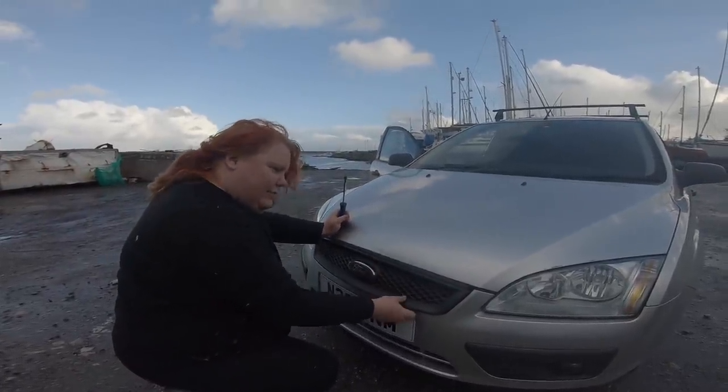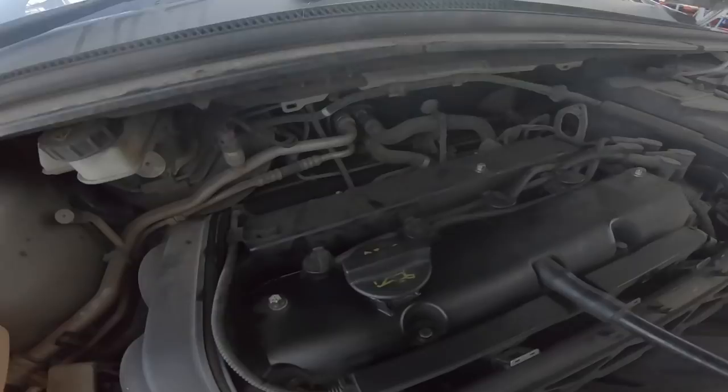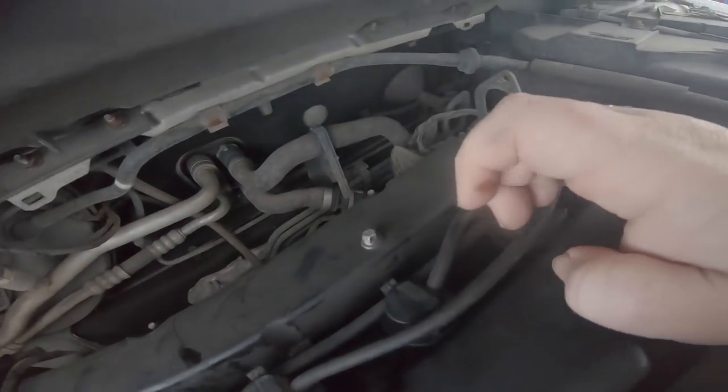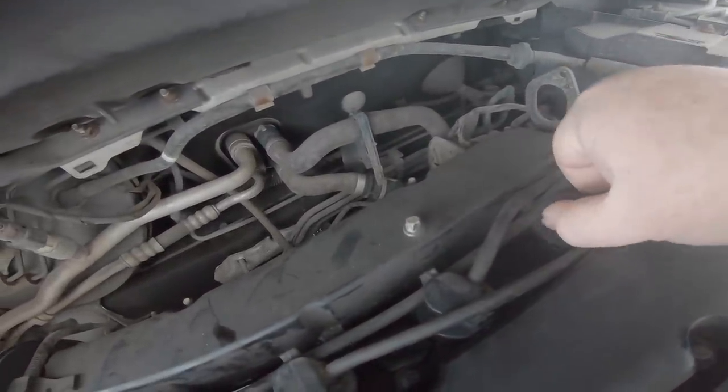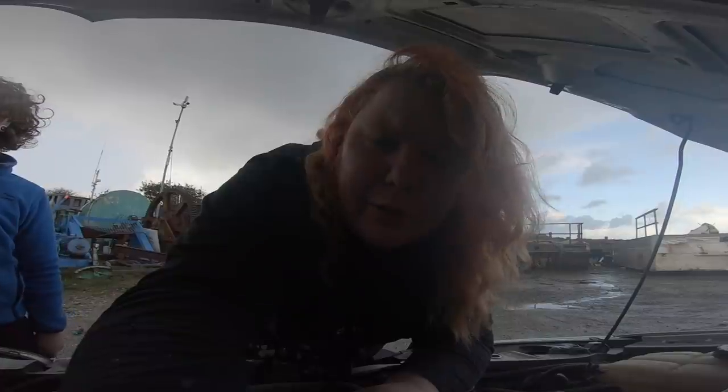What used to be under here was a key but now you pull this out. These are the spark plugs — it's very important to put them back in the same order, so I'm only taking one at a time. Oh, that looks wet — I think that might be the problem. There's lots of water in the reservoir where the spark plugs are and there shouldn't be any water in there. I'm going to clear the leaves, but it's just absolutely started pouring down, so I'm going to put the spark plug back in, shut the bonnet, go in the boat, and come back to it when it stops.